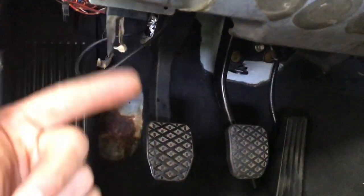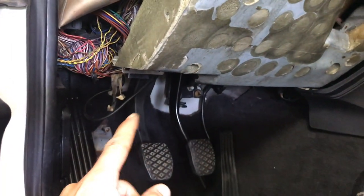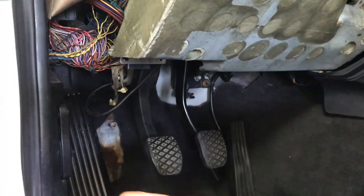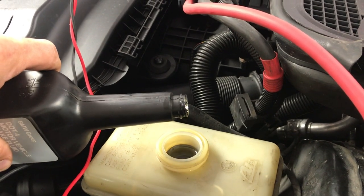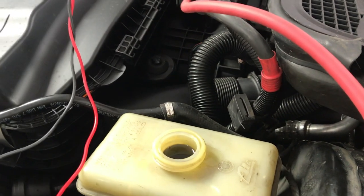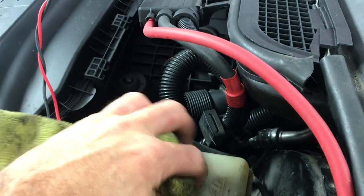And then I'll have to fill it up with fluid up at the top, and then close it and then push. And let's see, if I end up pushing this after I close the system and I get a little bit more back pressure, then that means that I'm getting air out of the system. Filling up with some more fluid, slowly. That actually is a little too fast. Okay, spilled it. Gotta spill it, or else you're not a shady tree mechanic.